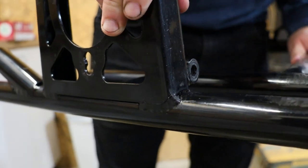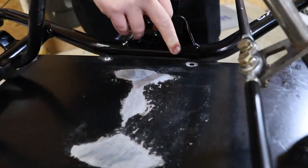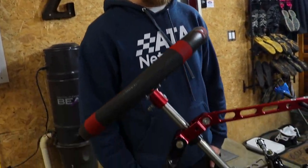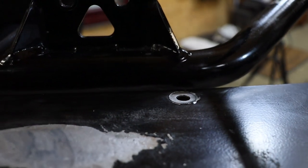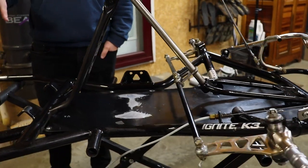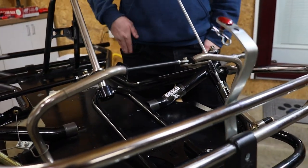You can hear that. Moving up to the front of the chassis, one thing we found was a missing floor pan bolt. There was actually a zip tie here that Lauer placed — zip ties are not solutions for floor pan bolts. I've tried that trick before; it's a common theme we also saw in our mid-season rebuild. It's very important that you have all the floor pan bolts in. It's not as critical as, say, the seat being loose, but every little bit adds up, and having this moving on us isn't going to help at all.